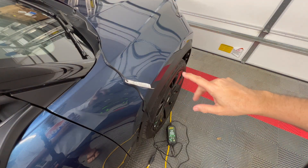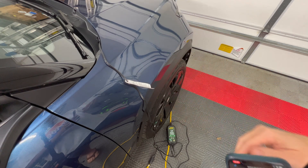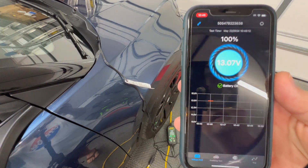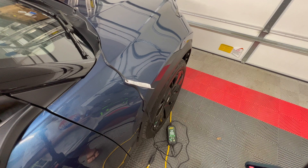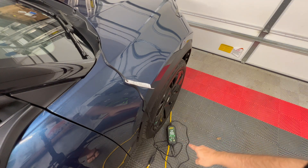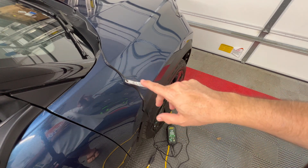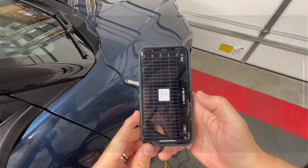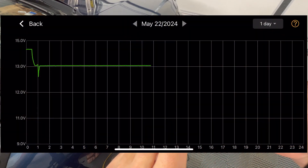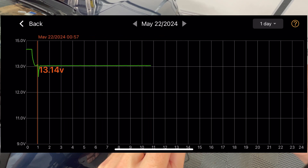Good morning. It is now 10:45 — actually 13 hours after I started charging last night. If I pull up the battery monitor app it shows that it is at 13.07 volts, and if I look at the battery tender on the floor it says the battery is fully charged, so it's actively not charging right now. Looking at the data, it shows that the battery has been a pretty steady 13 volts over the last several hours, at least since midnight or one in the morning.